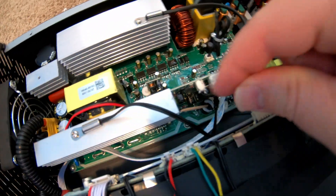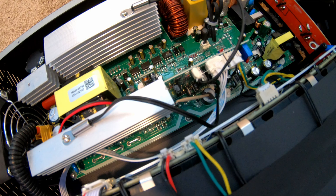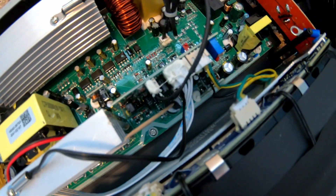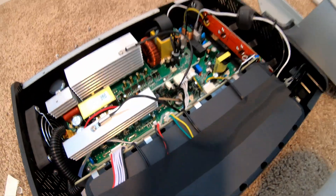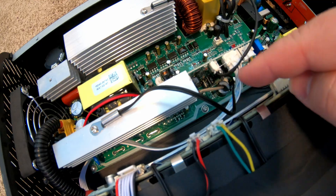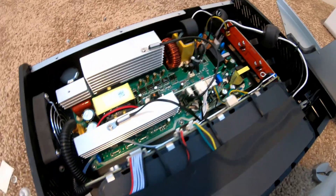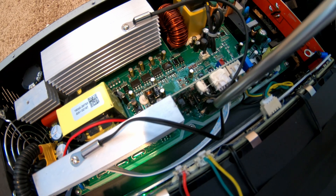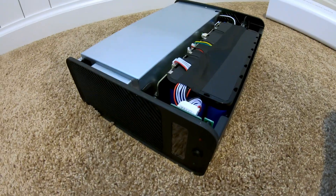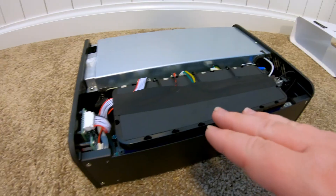If I put the screwdriver in here while it's on — you must be very, very careful not to touch anything — you can hear that now the screwdriver is on there, the beep is no longer audible or it's very, very muffled. Success! I think I've managed to mute this bad boy. I just stuck a toothpick in at an angle and wedged it into that speaker so that it can't vibrate hardly at all. The unit is on and if I'm really quiet you can barely hear it. I'm going to shorten this toothpick and shove it back in there. I've officially defeated the buzzer — hooray. I just cut the toothpick in half and shoved it into the speaker.